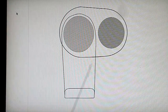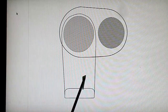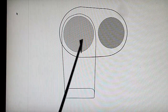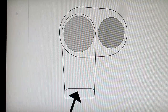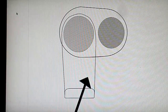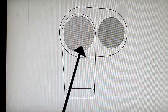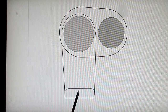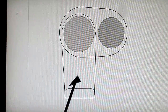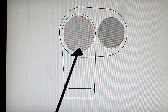Let's talk about where all our swirl went. On the stock port, we had kind of a bulge here in the casting, and we have more space on this side of the valve guide boss than the other side. So there was a tendency for the air to flow easier around this side. Also, the short side turn wasn't working very well, so we didn't have much air coming out here. The predominant flow was across the port and around like this — but only at high lifts, when the flow around the short side turn absolutely failed to make it.